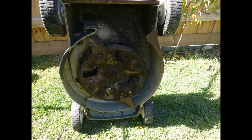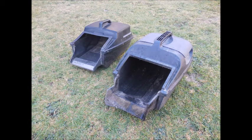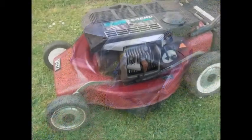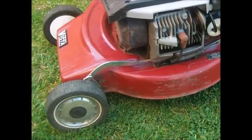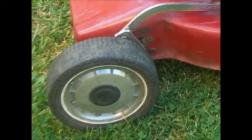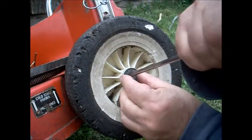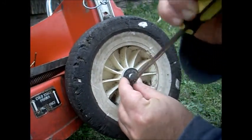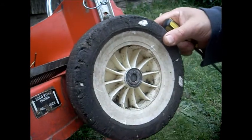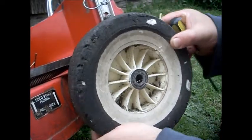Catcher: make sure the catcher fits your mower, there is no significant damage, and check the inside also. Wheels: with all the used mowers I've sold, only one buyer ever tested the wheels. Although Victor used them as a selling point, ball bearing wheels are trouble — invariably the plastic bearing races wear out and the bearing collapses, leaving you with wobbly wheels.